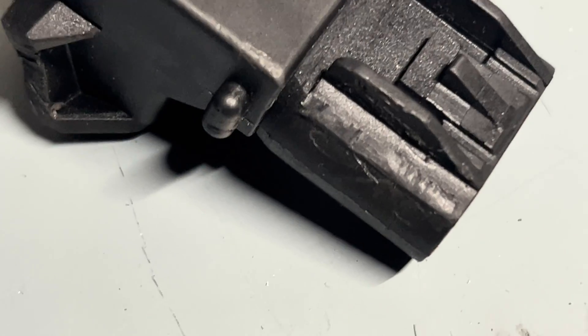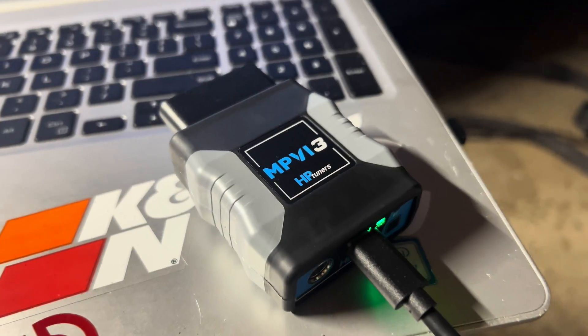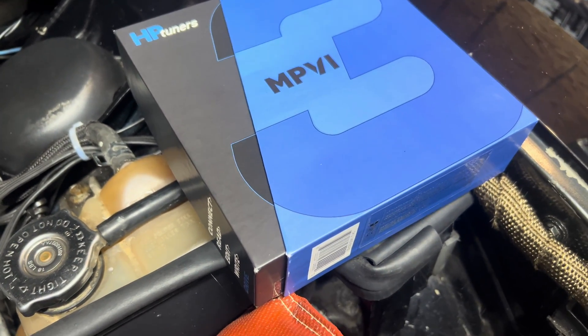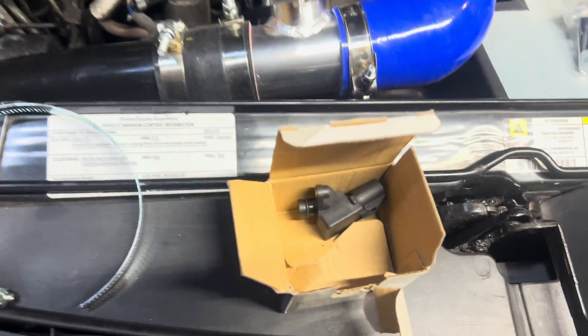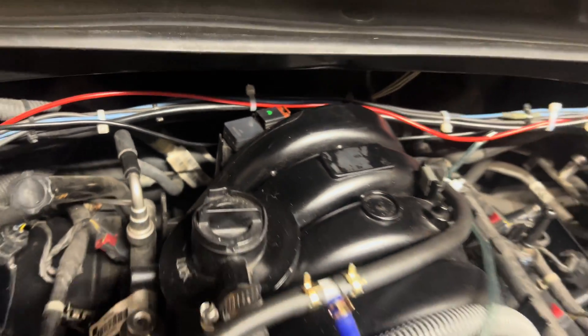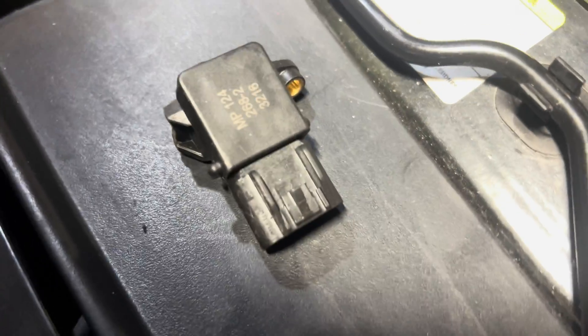As you can see, it has shaved away the tab that was there. I'm going to be able to tune in the new MAP sensor now, so I'll be able to put this one in. There's the old one — I've extended the wire there as you can see. So I'm going to take the old one out. I already have the new one modified so it will fit.